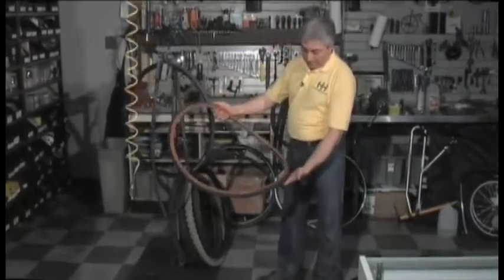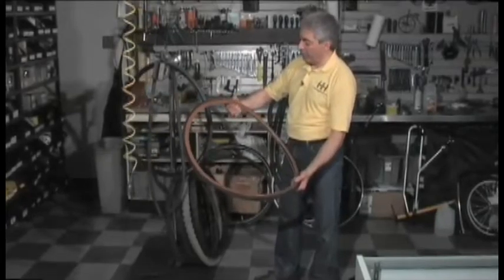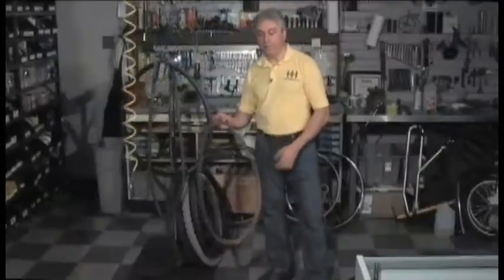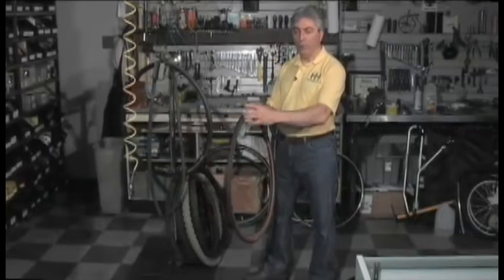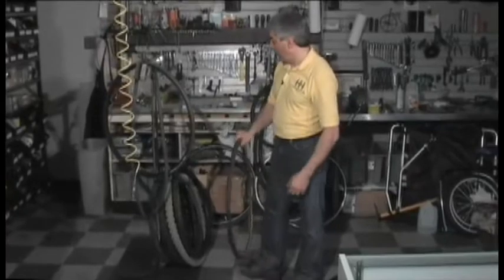This tire — what you want to do is, when you take tires off, give them a little bit of a squeeze. If you see cracks in the sidewall, or if you squeeze it up here and see cracks in the tread, it means the tire's dry — the rubber has seen better days. When it dries out like that, the danger is that the rubber isn't going to adequately hold the fiber inside the tire together, and it's going to blow out on you.